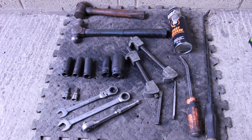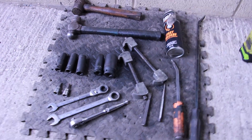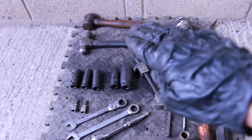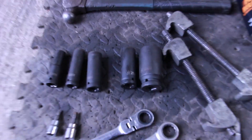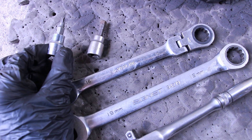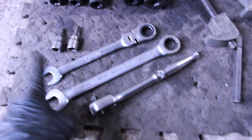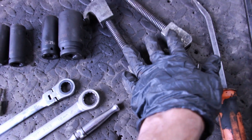To replace your spring on your Peugeot 207, other than jack, axle stands and a new spring, something to take your wheel off with — they're generally 17mm. A couple of hammers; something to help release the old rusties. Sockets wise: 13, 16, 19, 21, 30, and then some little tools — a 7mm Allen key, Allen head, and a T30 Torx. For the anti-roll bar, sometimes it's an 8mm or a 6mm Allen as well. A 16mm spanner, 19mm spanner, something to turn the sockets with, and then a punch, a blunt chisel, a couple of levers, and spring compressors.